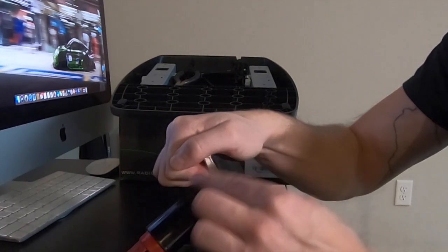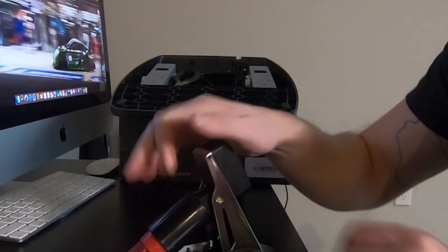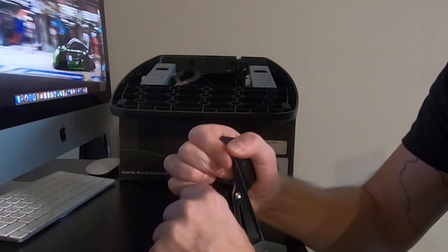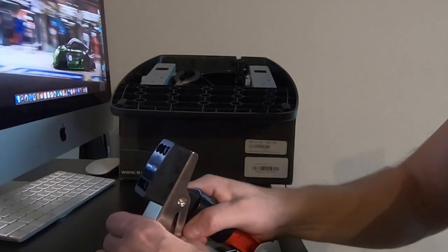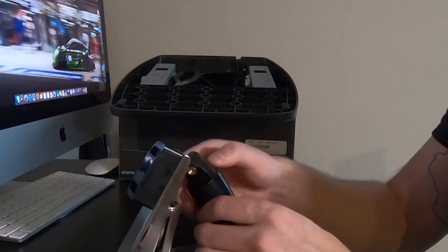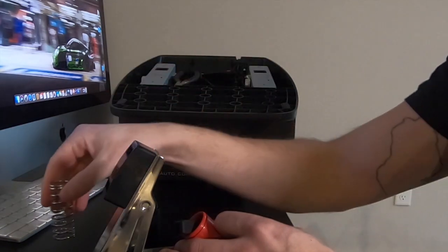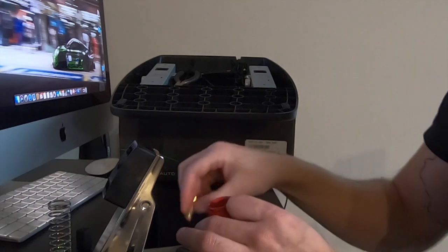The brake pedal is probably the hardest one of the three to do, mainly because the spring has so much tension to it. One thing don't forget is when you are doing this, I made the mistake of putting the clutch and gas pedal springs in the wrong sides because it's upside down, and I was stupid and put them on the wrong side the first time. I fixed it before I buttoned it all back up, but just remember that. So take all the springs out, and don't forget the rubber bushing that Logitech puts in there now to hopefully increase brake pedal feel.